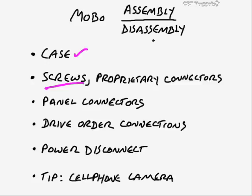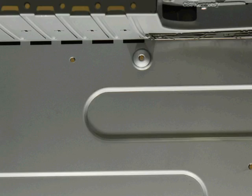Now, when you take a look at the actual motherboard and how you insert it, one of the things you'll first of all have to understand is a standoff. And the standoffs that you'll need, it could go a couple of different ways. In this particular case, no pun intended, but in this literal case right here, we have these items. These are kind of little bumps that appear off the floor of the case. And then what you would do is when you install the motherboard, it rests right on top of this bump.